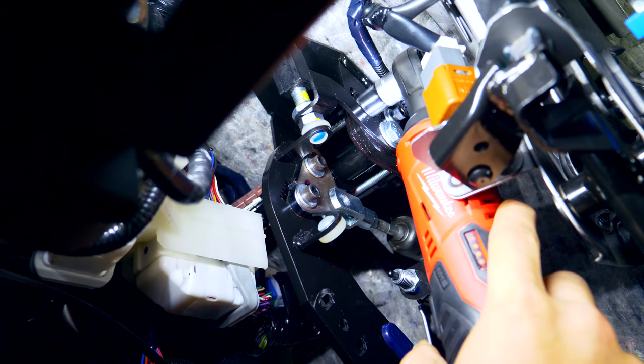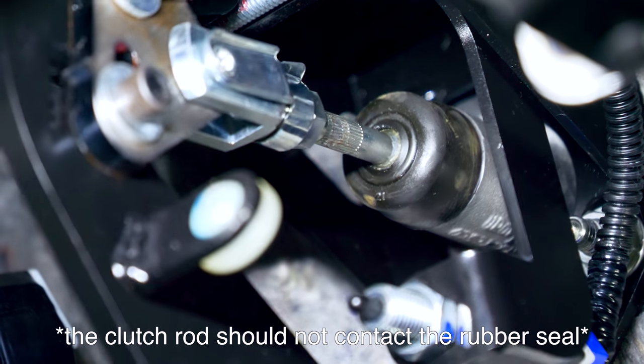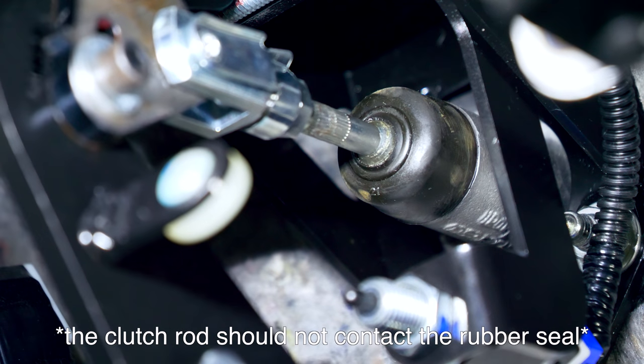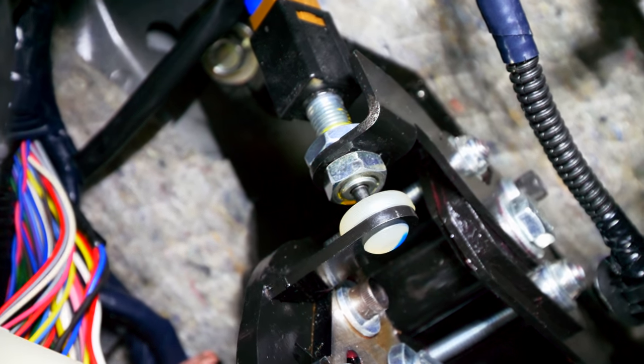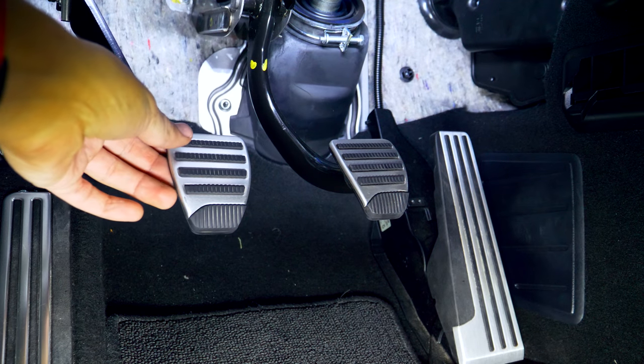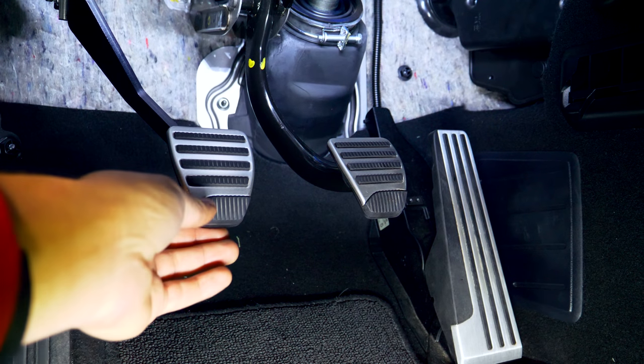Start by loosening the two 12mm nuts on the very top of the assembly, which allows the lower part of the pedal to be dropped or raised. This is a very important adjustment — it allows the clutch rod to be positioned so it only moves in and out, instead of also moving up and down. If it moves up and down, you'll prematurely wear your clutch master cylinder and potentially your clutch as well. Once adjusted, inspect the switches to make sure they're depressed when the clutch pedal is in its resting position, and the other switch when the clutch is fully engaged. Following that, adjust the physical position of the clutch pedal in relation to the other pedals — I lined mine up with the brake pedal. There are plenty of other adjustments to play with, but this covers the basics. More fine-tuning information can be found in the description box.